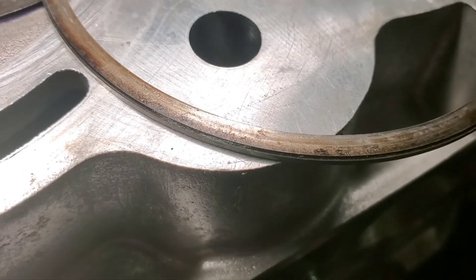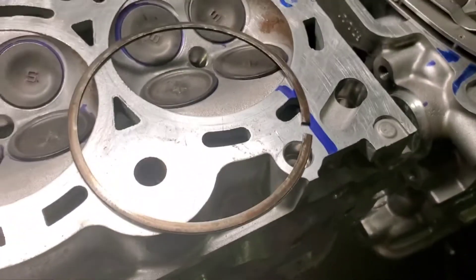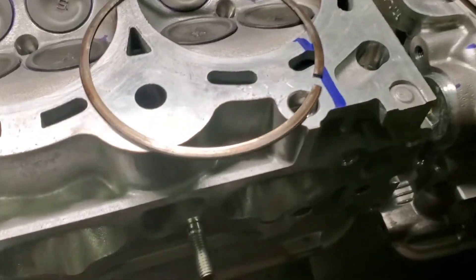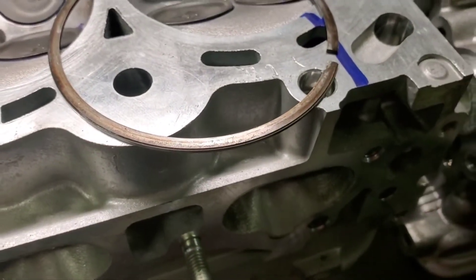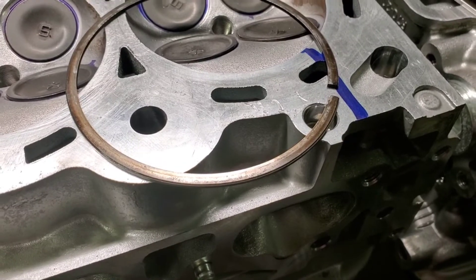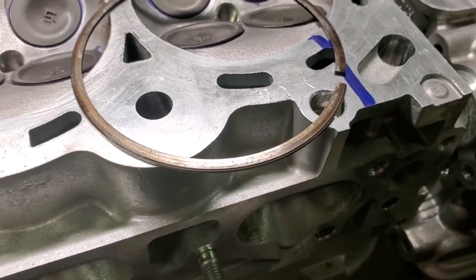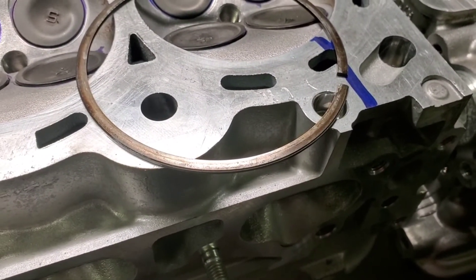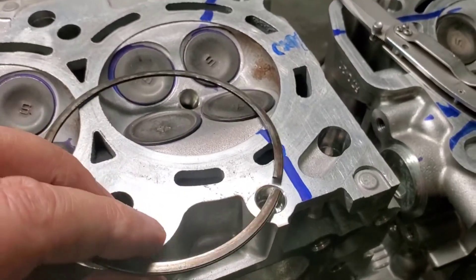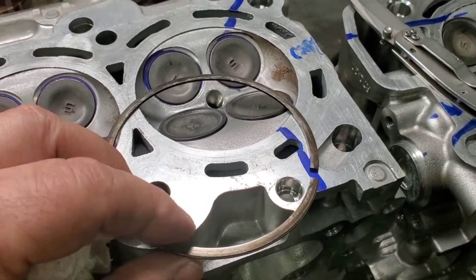In this video I've got a picture of the piston ring that came off of Steve's blown 383. Upon further examination of the stuck piston rings, this ring is a Napier style second ring. A Napier style is a second scraper ring that's got a hook machined into the face of it. This was installed upside down with the hook in the number one piston groove, with the hook installed towards the cylinder head in the number one position.